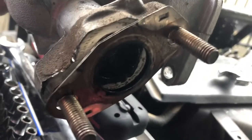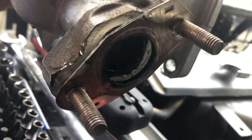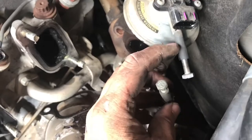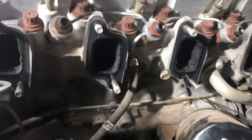You can also see the inlets there, and that's the EGR - that's actually where I'm going to block it, which is the inside of the manifold. You can see that washer there - that's where I'll be putting my block, basically a bit of shim covering the hole. So the two ways to block your EGR: one is to block the vacuum hose - this one's been cut by the previous owner and you can just put a ball bearing in it - or the second way is putting a plate over that section there at the manifold.